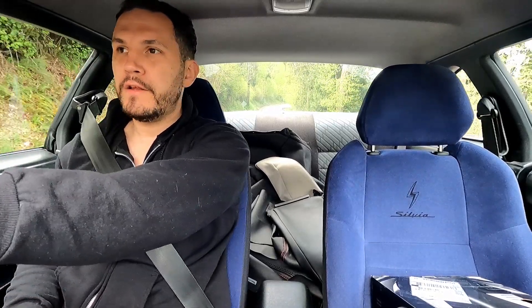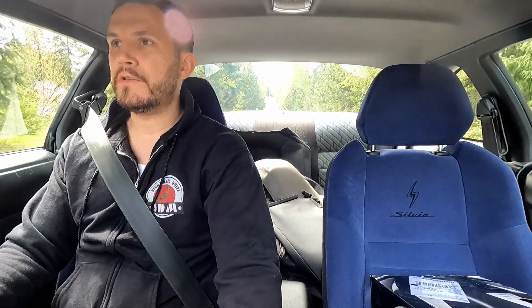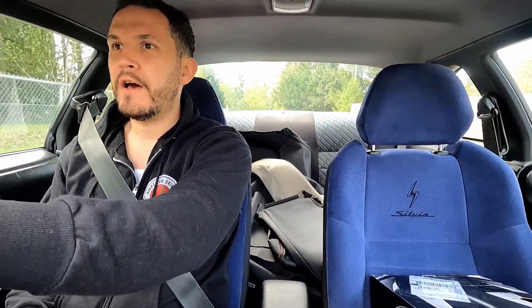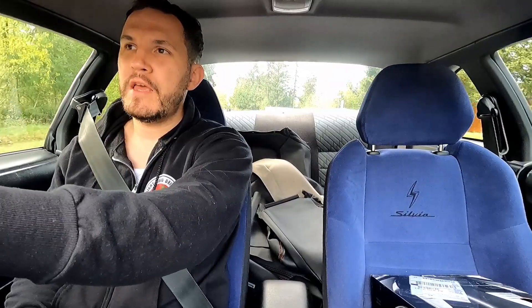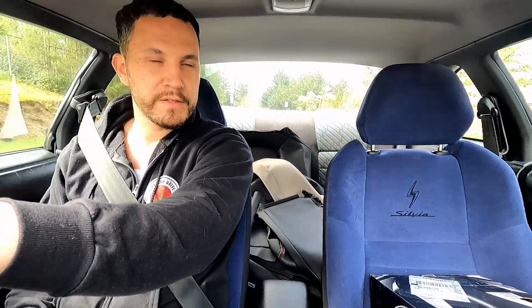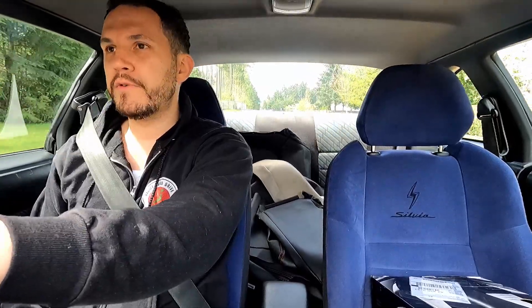The car still is pretty much impossible to drive with it not being able to rev. I wanted to go put some newer gas in it before I drive it up to the shop to do some work on it, because this gas has been in the car for about a year. I haven't driven this thing since I bought it, so it's nice to at least get it out on the street. As long as I keep the revs down, I can drive it around in limp mode, which is kind of a pain, but it's nice to get it out and get a feel for it. Before it was fully warmed up, I kind of revved it, but I forgot I don't have a blow-off valve — I just have tape over the blow-off valve flange, and I blew the tape off. So my car basically had an air leak, throwing off the air-fuel ratios. But I'm just chugging along here, putting about 1,800 RPMs and driving through town, and it's fun.